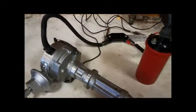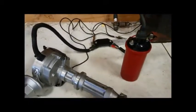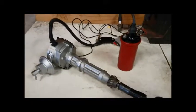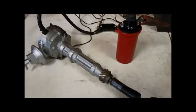And so what we get out of it — you can see I've got the electrode cut off completely on the spark plug, so you can see the amount of gap that the spark has to jump in order to complete the path. This allows you to open up your plug gap to about 40-45 thousandths, giving you a little bit wider gap, hopefully helping a little bit with the burn and giving you a stronger ignition.